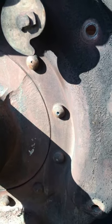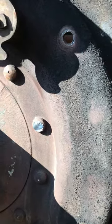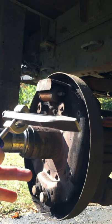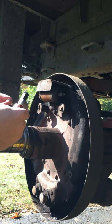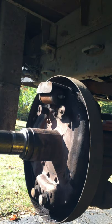We've got our 1/8-inch pilot hole drilled already. Come back in a few seconds and I'll show you what that 3/8 looks like. That's pretty much where you want it right there. It doesn't have to be exact — as long as you get enough of the rivet head drilled out where you can easily just take a cold chisel and chuff that right off. So this here is my weapon of choice — a halfway decent hammer. A couple of good whacks with this thing and it'll come right off. Just like that. You just repeat that 11 more times — I'm not going to bore you with the details because it's just basically what you just saw.